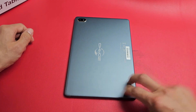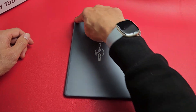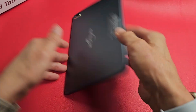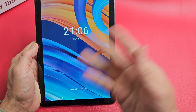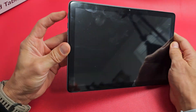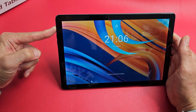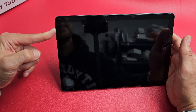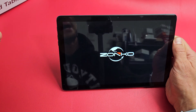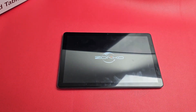If it's still black, no problem — turn it over and do the same thing on the back. Tap kind of hard all over, even all around the camera lens. Flip it over, tap that power button, and see if your screen is on. If it's still a black screen, press and hold that power button — do not let go until you see the Zonko logo, then let go. Hopefully you are now out of the black screen.